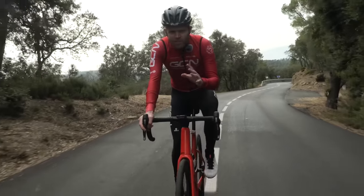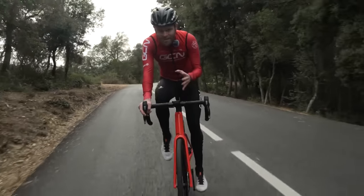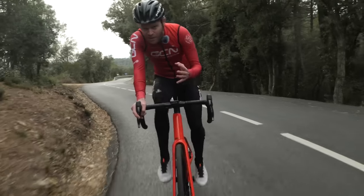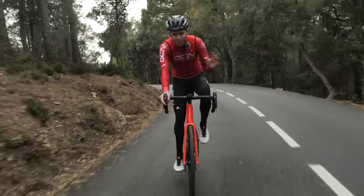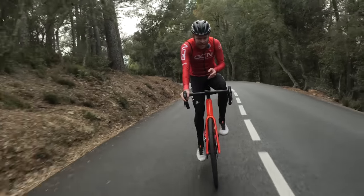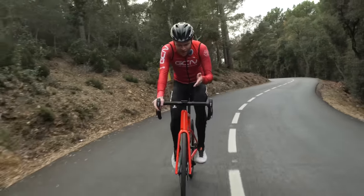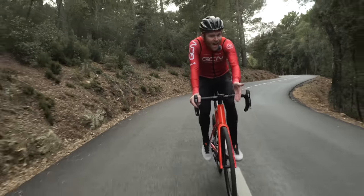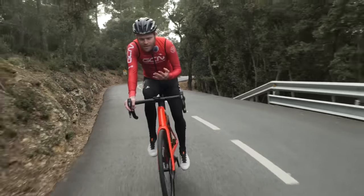But by far the most significant factor in the difference in range between the two bikes is going to be the tyres and the tyre rolling resistance. So if you were doing an absolute max range test with the two bikes on tarmac like this, then the road bike is going to have greater range because the slick tyres are just so much more efficient on this surface, with lower rolling resistance.